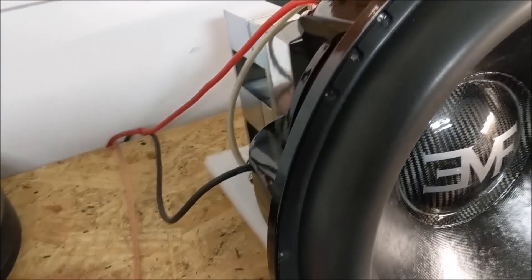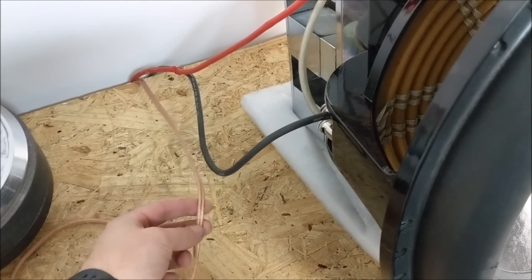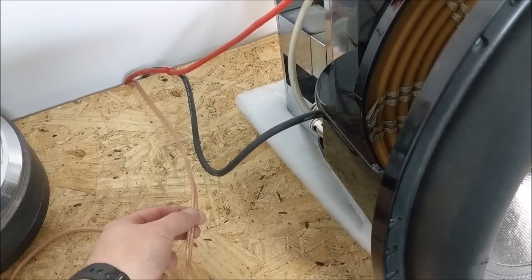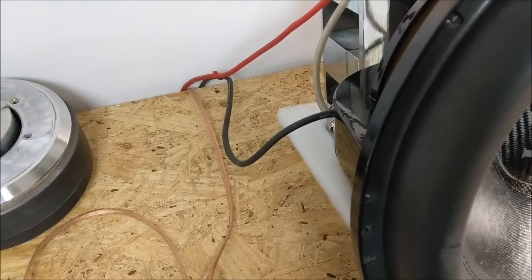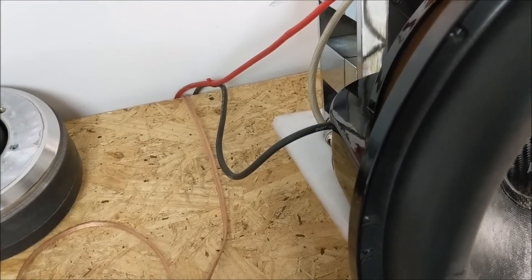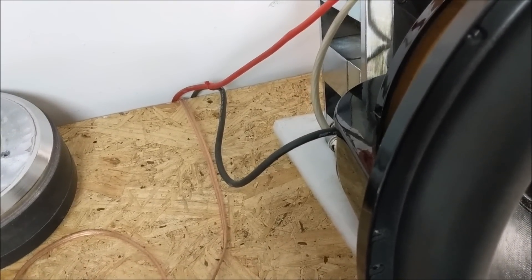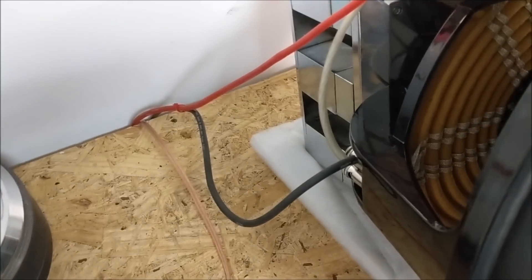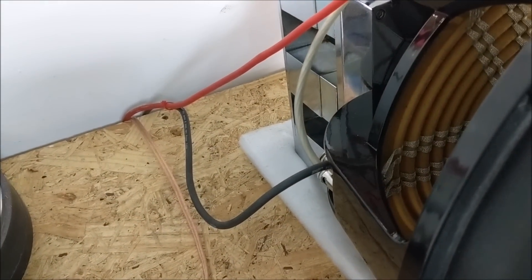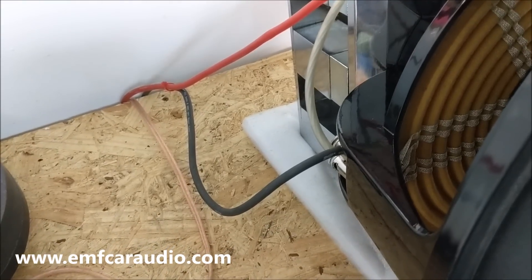So what did we learn here? A larger gauge wire will accept way more current than smaller wire — these are things you should already know. Between 16 gauge and 8 gauge is a lot, even at 1,200 watts. This is wired in parallel on a dual two ohm, so it gives you more current. If you had it wired in series it would have less current, more voltage, and it wouldn't heat up as fast. Running at half ohm or quarter ohm is going to affect wire size even more. Even at 1,200 watts, 16 gauge wire gets hot.